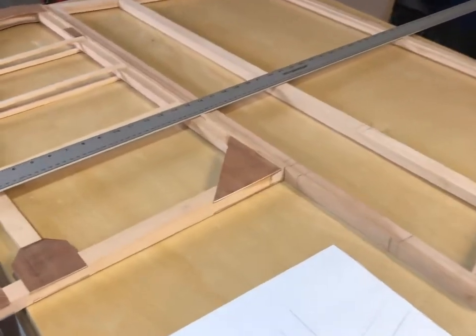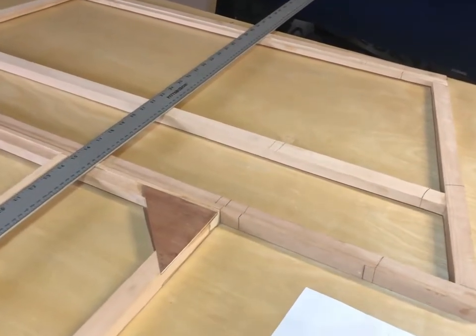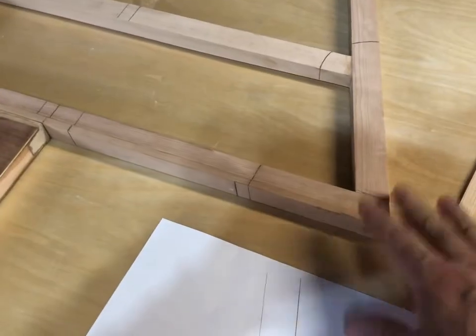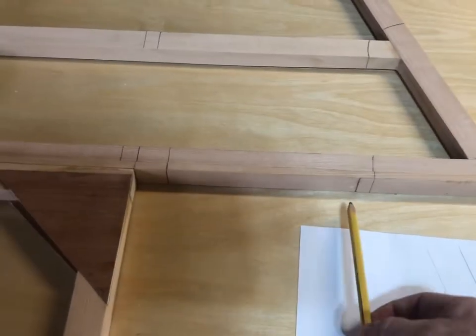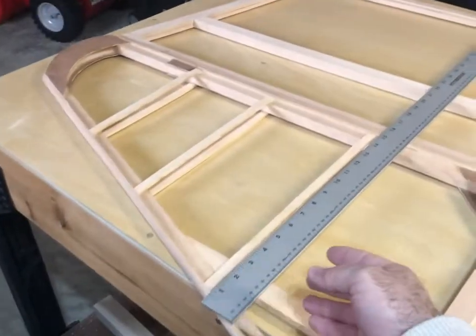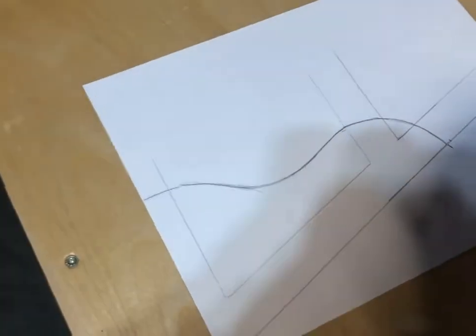A little bit to unpack here. I want to kind of kill a bunch of birds with one stone. The rudder was popped out of the jig — I just glued the frame together but not the gussets yet, I haven't even cut them. I'm measuring off places like the hinge, the gussets — this is the elevator that fits underneath, and this here is one of the ribs. I'm using a long straight edge to match up each rib so they're all in line as they go across the rudder. I've also traced out some gussets using these style gussets.